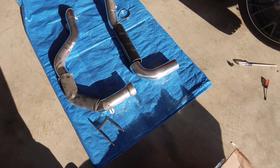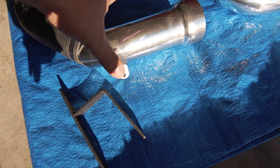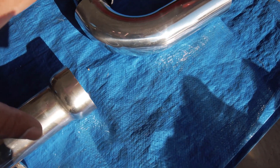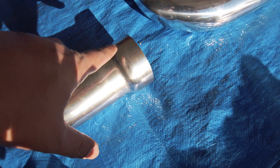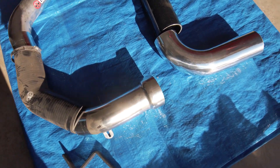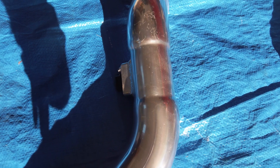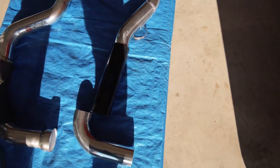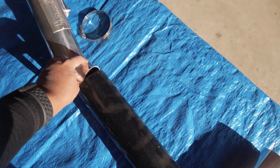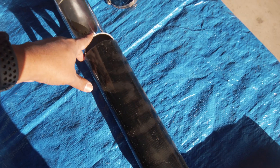Quick comparison: the passenger side is out. Here you see the Takeda — one thing I really liked is the mounting point to hold the filters nice and flush. But you can already see the diameter difference. The Takeda actually had a three-inch inlet for the filter but then went down to stock pipe size. Because of the stock mass airflow size, it restricts airflow further down. You can see the size difference right there — a whole lot more air and volume with the three-inch.